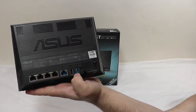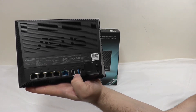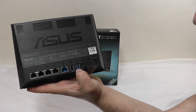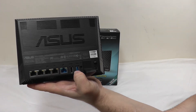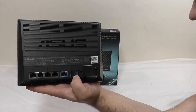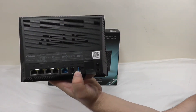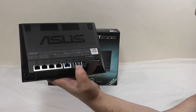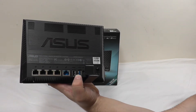With these USB ports on the router you can connect all types of things — a storage device, a 3G/4G modem for internet connection sharing, or even use it for printer sharing. If you plug a storage device into the USB 3 port, which you'll see was tested in the benchmarks, you'll have plenty of speed to stream anything you want, especially using special features like the AI Cloud Disk, which allows you to access your disk through the network — essentially creating a NAS (network attached storage) device.